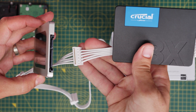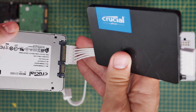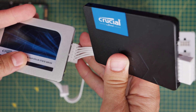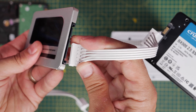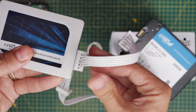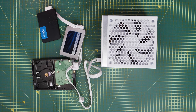This cable can be plugged into multiple drives, so you can power multiple SSDs and hard disk drives from a single cable really easily — daisy-chaining them all together. However, if you're using multiple fan controllers, you might want to use two separate cables, because the power draw might be too high. So if something's not working, it could be that you need to use both cables rather than powering everything from a single one. But for drives, you can basically plug them all in with one cable.